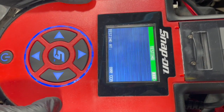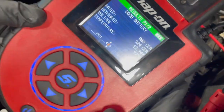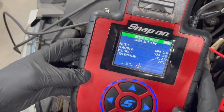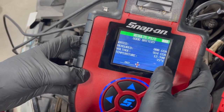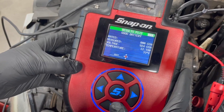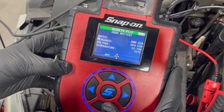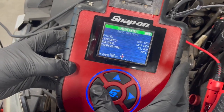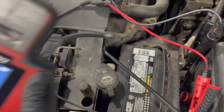It's taking into account that temperature correction factor for the voltage — good battery. There are our results: 924 cranking amps at 12.7 volts, 77 degree temperature on this particular battery. It kind of gives you a little graph there if you need that. Push exit and we're back to the main menu — that's a battery test on this machine.